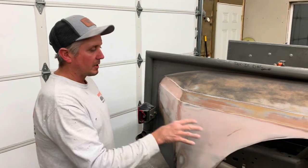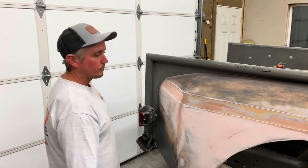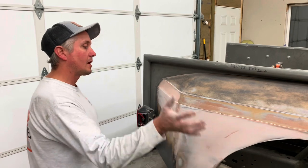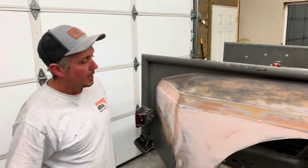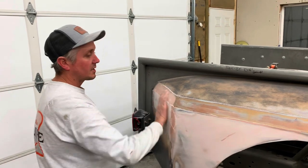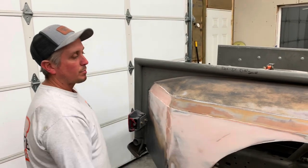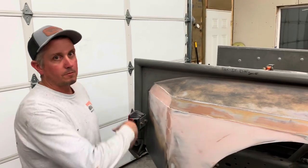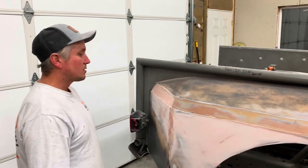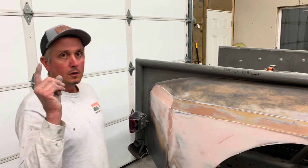I got all the fiberglass repair done this morning, and all day I've been sanding and applying bondo and sanding it off again. This side is almost ready for primer. I'm going to finish sanding all this stuff and then I'm using a poly primer that's good for going on fiberglass and anything that's not bare metal. That's going on next, and then tomorrow we keep going.